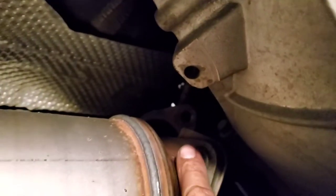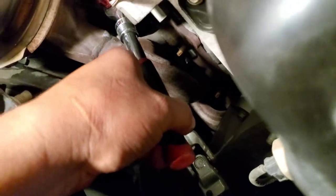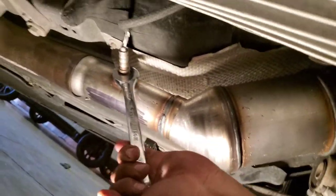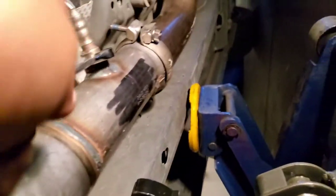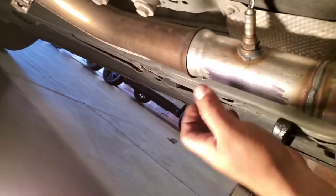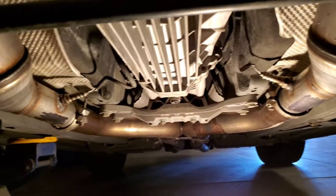There it is, I got it in here. Now I'm going to put it up there. Now I just got to bolt it down right here and then bolt it down over here for the O2 sensor. These I was able to reach from underneath just fine. Let's go ahead and tie that one up and put in the oxygen sensor while we're at it. We'll use a seven-eighths to secure the oxygen sensors down. Let's go ahead and tie our exhaust clamp down — there it is. Swing it over and tie down. Everything is back together.